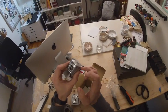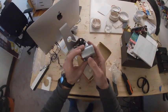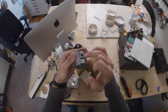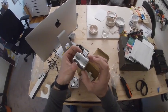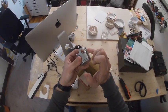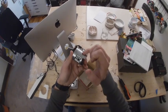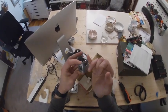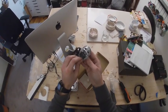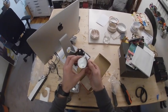The kit comes without the rings installed and without the circlips installed. This piston you want to clean up with a file — I'll have a short clip on that tomorrow. More importantly, right over here it's pretty sharp, so just very quickly take a round file and go around the edges. The back side is pretty good but it doesn't hurt to clean it up — you don't want any sharp edges when you're firing up a motor for the first time. Just deburring it.